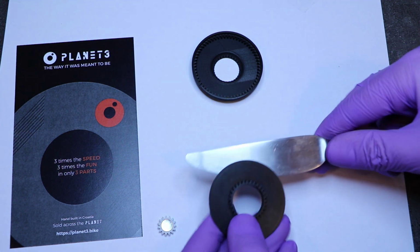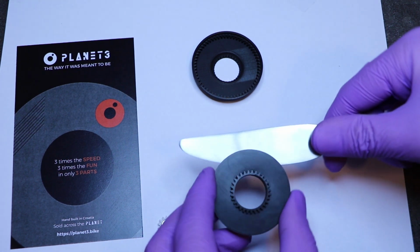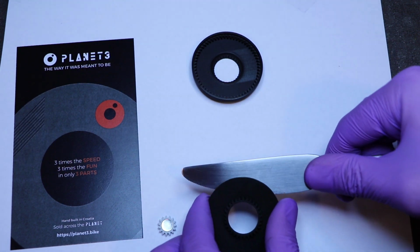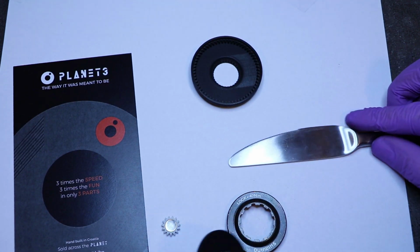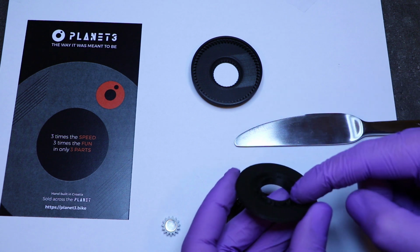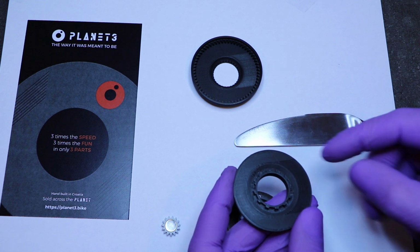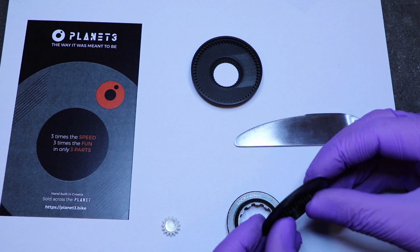So insert and then just hold the Sun Gear, okay, and then move on slightly. Okay, and it falls out with some drama, okay? And that's it. I will press fit this the first time so that it goes through the plastic deformation here, and then it will be very nice and easy to remove every other time.